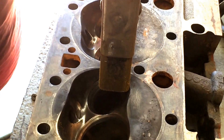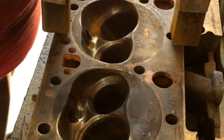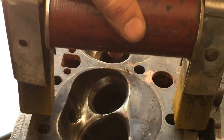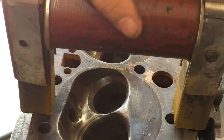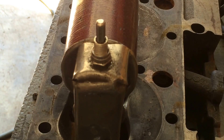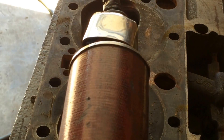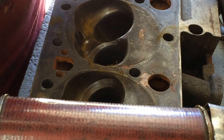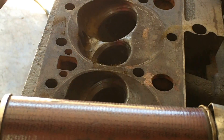It's one cylinder. The reason you don't want a crack in this is because you have coolant ports that run right around these valves to cool them. If there's a crack, you're going to suck antifreeze up and burn it, which is going to eventually cause it to overheat and do damage to your pistons. When it runs hot, it will leak into the cylinder. You get enough into a cylinder, it'll do what they call hydraulic a cylinder — fill that cylinder up with water. It's like filling it up with metal because it doesn't have anywhere to push. It'll just bust a piston, bend rods, bend a crank, do all kinds of stuff.